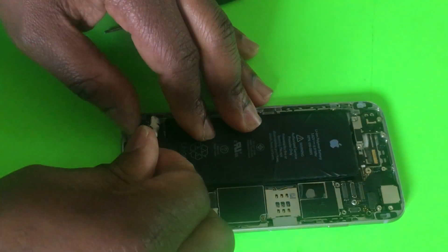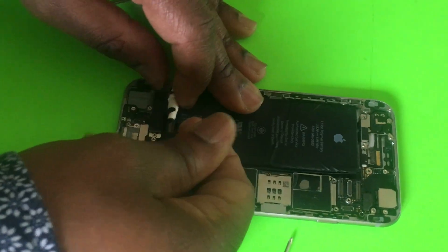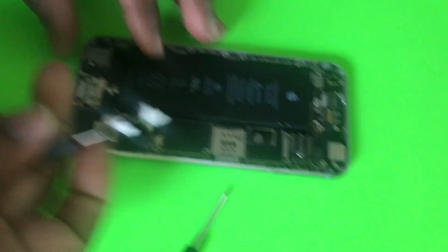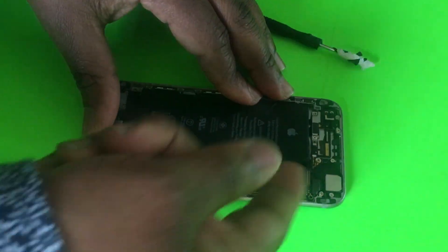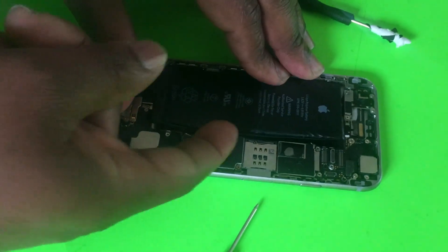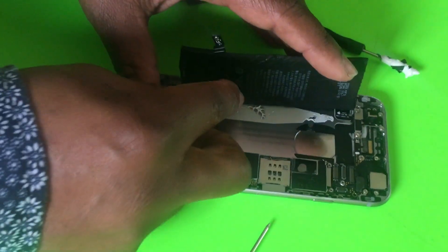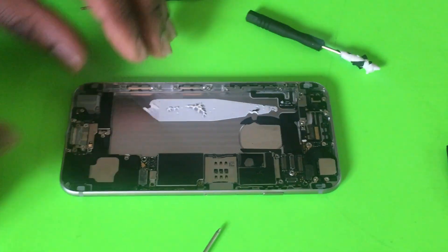The adhesive is kind of loose already on one side. I think this one is going to break, but at least we're able to get rid of one side of the battery — so the battery is actually loose on one side. I knew that one was going to break, but at least it's loose on this side. All you've got to do is put a finger or something sharp from underneath the battery and push it up. There we go — it's up.